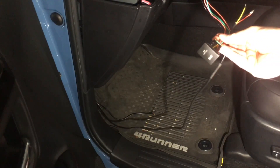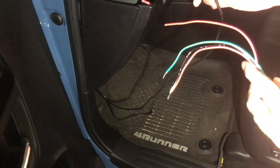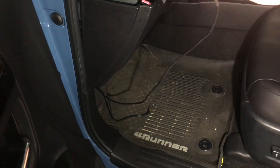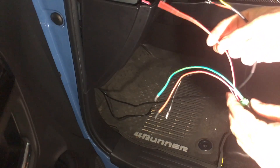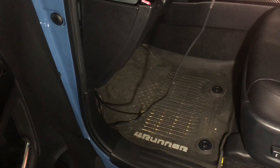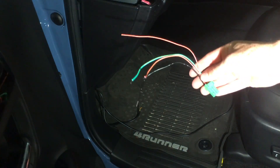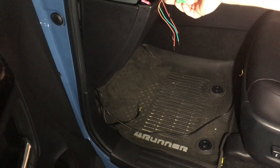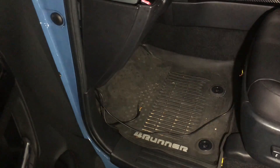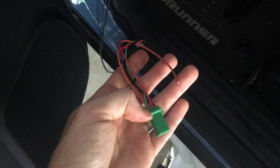I'll go ahead and put a wiring diagram for the cali-raised ones up here. Basically for the cali-raised ones, the yellow is going to go into green. Your light bar may be completely different, but I'm going to go yellow into green, red into red, and black into black. And eventually if I want to tap this one off to have it run with my dashboard lights, I will. The easiest way to do it is these two disconnect — take this out, do all your stuff up, run your harness back into the vehicle, and then plug it into the module. So yellow was to green, red was to red, the second red from the green again as from the wiring diagram, and then black to black.